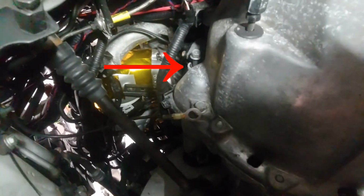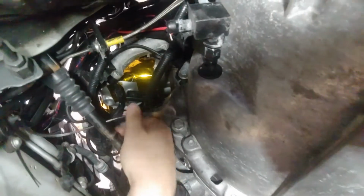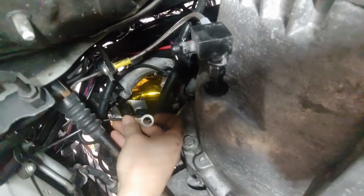Okay, so I don't know if I'll be able to point to it, but you can see that one bolt that's sticking out. That's the top of the starter. So I suppose you could probably use the bottom bolt, but I wanted to get it as far away from the steering as possible. It would honestly be a little bit easier to install if this was like a U shape. I don't know if I would recommend cutting this, or if they would put a different one on it, or if there's a reason, like if it would vibrate loose. But the only thing that kind of sucks is that you have to take out this entire bolt and then slip it through.